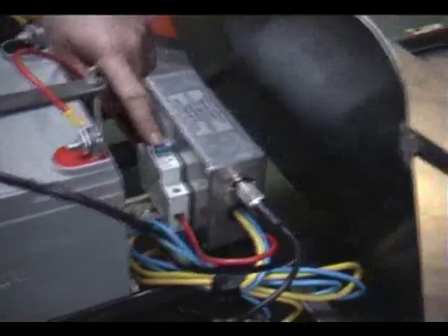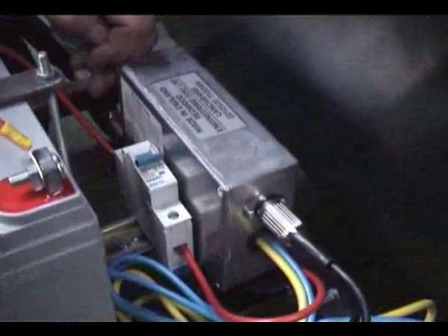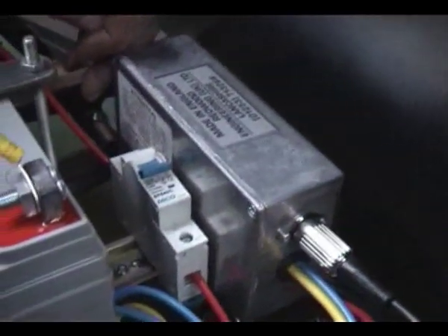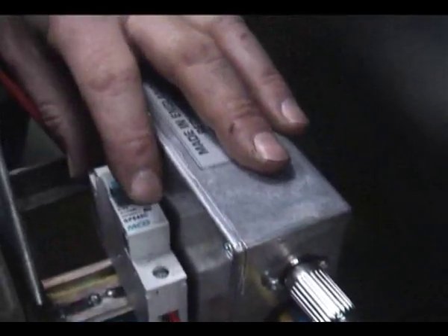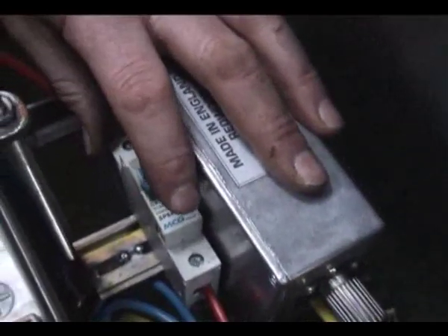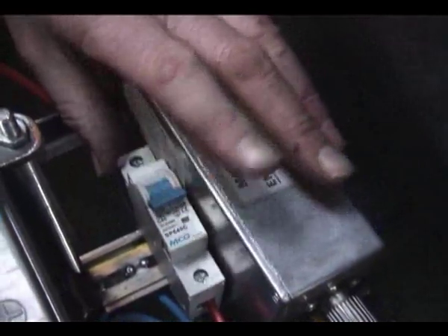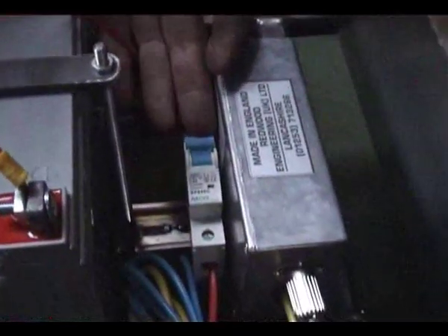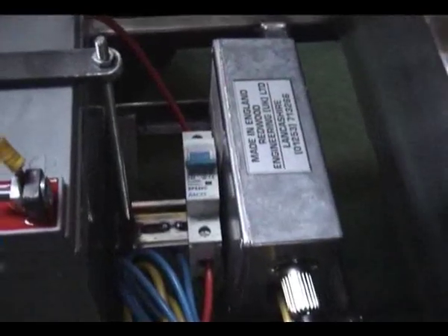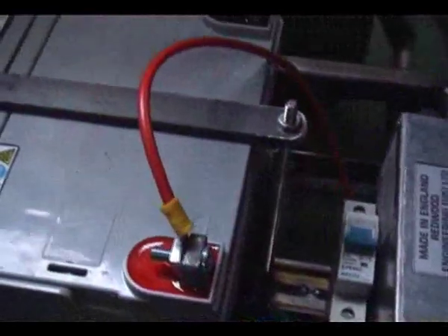So it's a gradual throttle rather than just a simple on and off. This is protected with a 40 amp circuit breaker fuse, and we also use this as a simple on and off device. So when the cart is in storage, if the batteries are connected you have an off position, and then to turn the cart on you have an on position. This will also trip if there are any electrical faults, as a circuit breaker it will simply click itself off to protect the controllers.